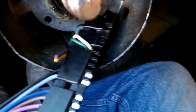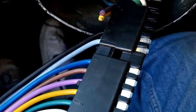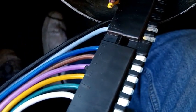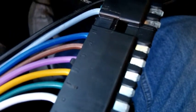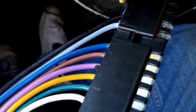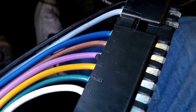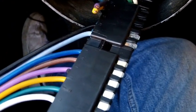I used to run into this with windshield post-mounted antennas when they'd go through a car wash — they'd snap the antenna off and want a replacement mast put in. It's almost impossible to run that wire independently without some help. So what you'd do is tape a wire rope securely against the old lead, pull the lead out through the antenna windshield hole, then tie the new antenna lead to the wire now in place and use that to pull the new lead in. It's the same principle — I'm going to try that with this.